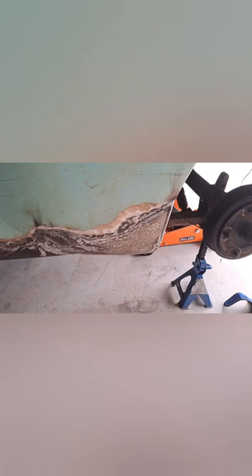So everybody who's been following our channel knows that we've gotten everything to the stage of getting the sill all done. So, doors closing, pretty good, not bad. We're just about to do some work on the back section here. We've got it clamped and ready to go, so that's done. I've soaked the fasteners in the rear tailgate so we can take that off, take the glass out and actually do some rust repair. As you can see, it's pretty bad.